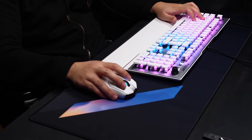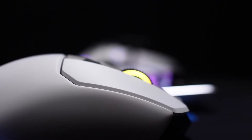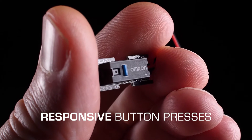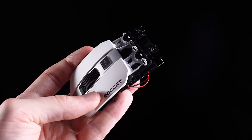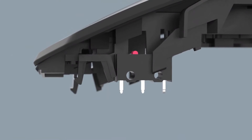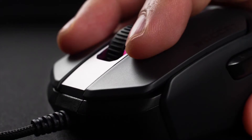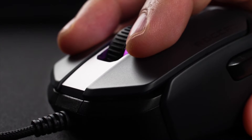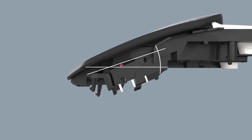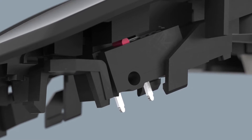It lets you control the click more rapidly and in a precise moment — precise, balanced, fast. The switch lies at the center of it all. We made two major changes to the switch to significantly improve its performance. First, we elevated it so that it is positioned immediately below the button, providing a more direct and responsive feel with less between you and your click. Second, we angled the switches to match the slope of the buttons, so buttons make contact with all of the switch rather than just a part of it, with a greater concentration of force.